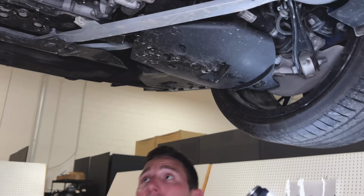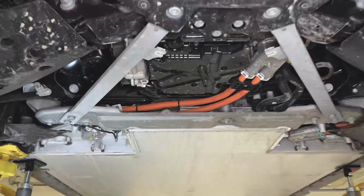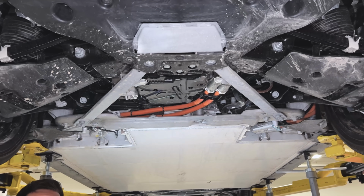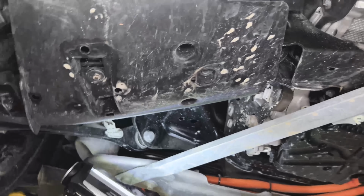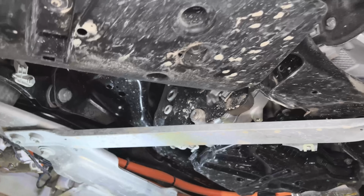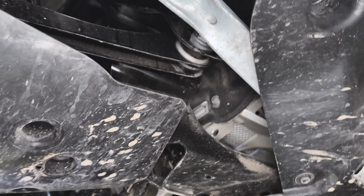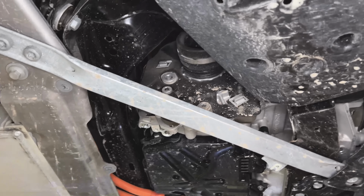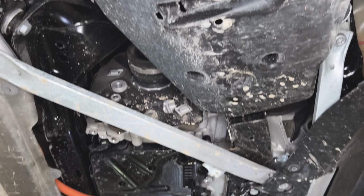Okay, coming to the rear, there's a lot of structure going on here. So in typical BMW fashion, or I'll say 3 Series size vehicle fashion, they've got a stamped, and it looks like partially hydroformed, MIG welded steel cradle that is isolated to the body from what I can see, which means there's a rubber bushing in between the subframe and the primary body structure. And they would almost always do that on a rear-wheel drive application, which most BMWs are, so that you're isolating all the vibrations from the powertrain to the cabin.